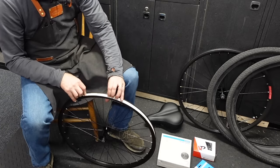All right, so here's the new chain, the 9-speed Shimano. It's the new stuff, the one chain to rule them all. I want it so the derailleur's pulling on it in the high gear. I think this is the one we remove. So one, two, three, four, five. Remove the fifth one. Break the chain there. Chain came with this quick link. Line them up, slide them in.